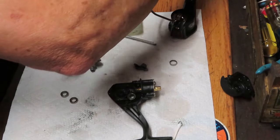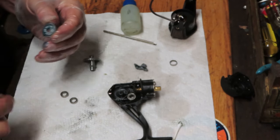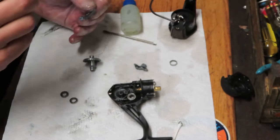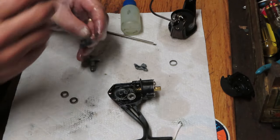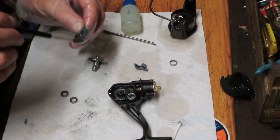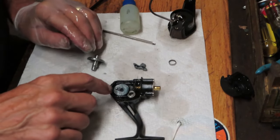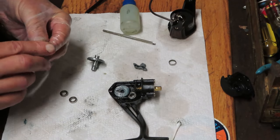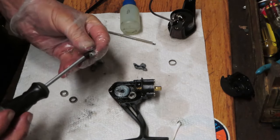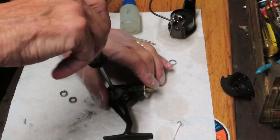On the oscillation — there's a bearing ball right there, and more little balls there. I'm continuing to check as I work through this. The fear is that if you leave one sitting in there, it'll get into the gear teeth and start shredding them. When you put the oscillation gear back on, make sure you put it in the down position — that'll make detaching the crosswind block easier.